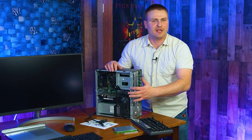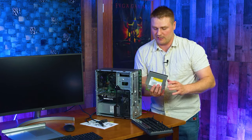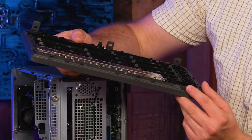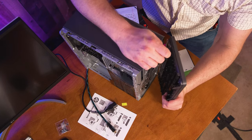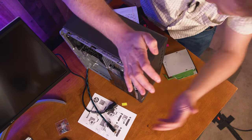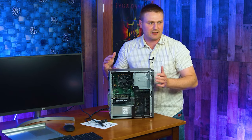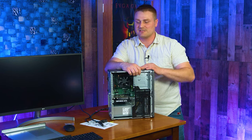I'm going to show you how to put this DVD tray back in. This does not go back in first — we need to put the front panel back on. It swings like a door: the silver side goes to this side, and there are three catches. You've got to come down and in — make sure it gets caught, you'll feel it — then swing it like a door and it snaps forward. Pop this guy forward, the green latch goes down towards the bottom, then this guy slides in. Close your door and that's everything. I'm going to get the case and wires plugged back in.